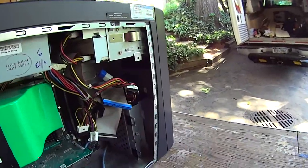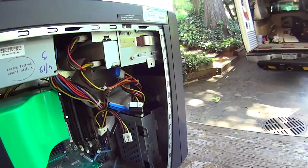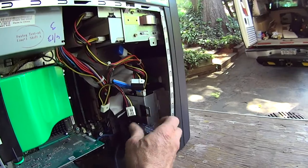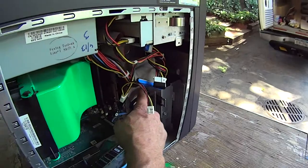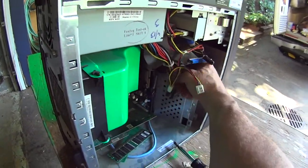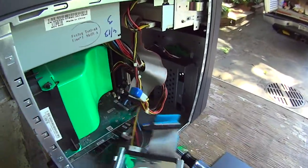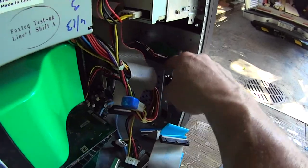What we're going to do with our Phillips head is come in here, push some of these wires out of the way, and there's a screw back here. Although different computers and manufacturers will have the screws in different locations. And once we remove that screw — and there may indeed be even two screws you would look for — basically we can just take the hard drive out. Now, if there was a second hard drive in this particular computer, it would be in this housing here.